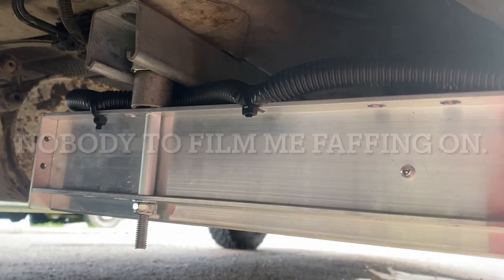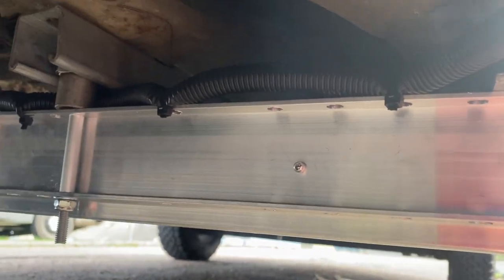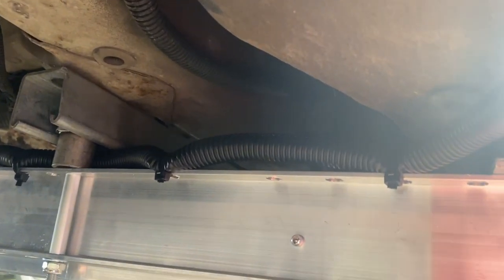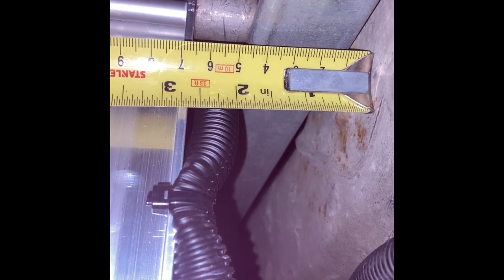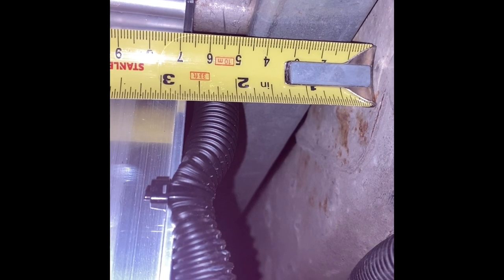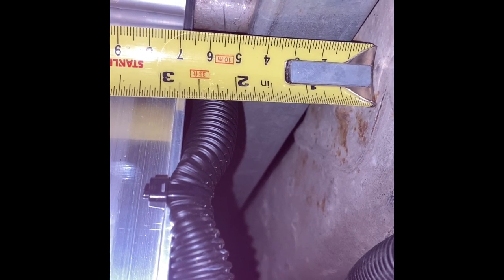There we have it — it's in. I seem to have measured the spacer okay. Trial and error will come when I open it out, and if I need to increase the spacer, well, that's not a big hardship. I've got the cable all nicely clipped on. The step is nicely horizontal on my van. I've got the standard unistrut of 45mm plus a 20mm spacer, giving an overall drop from the inner chassis of 65mm.